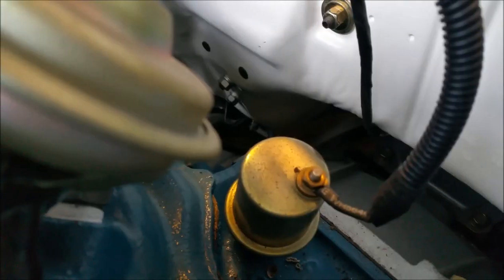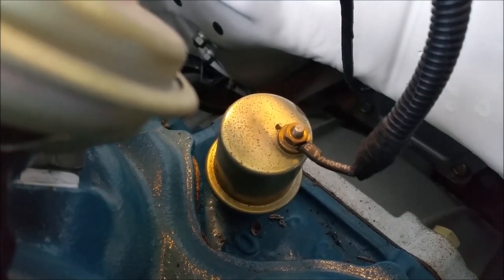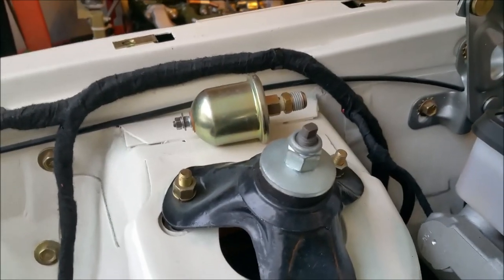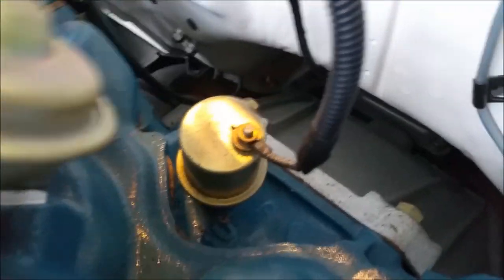This sender down here, it's measuring 250 ohms and doesn't work on the dash. There's gunk down there. Is that snail crap? And I've changed it. Well, I measured that one there as well. That's off the running stand. And they're both measuring 250 ohms. I think that's the wrong one. Harvey gave me the resistances and I wrote them down. But I don't know. I've changed a bit of cardboard since then and forgot to transfer them over.